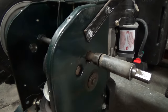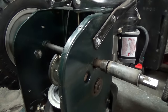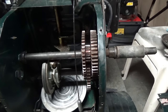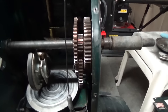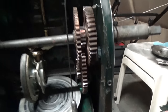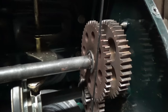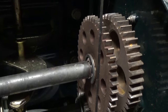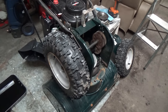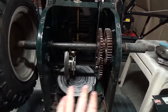Now that we've pulled our bushing out, the axle on this side has been lifted up slightly, which is enough to go ahead and spin this slowly. We don't want to damage anything because it's slightly making contact with the bottom gear, but what this proves is that nothing is seized in here. The axle is spinning so we know we're not seized on this gear. I'm going to do the same thing on this side and then start working on the bottom axle now that we've identified the problem area.